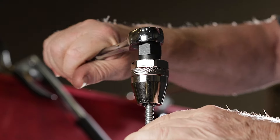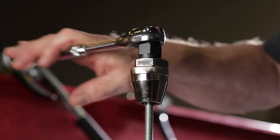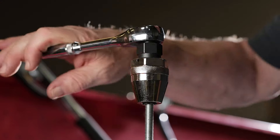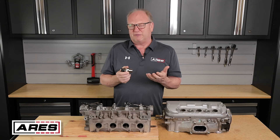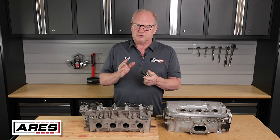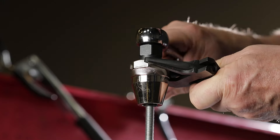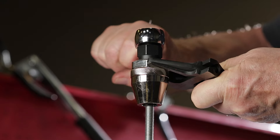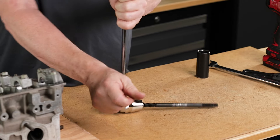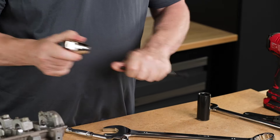By using the 3/8 drive or the 15/16 inch hex, you're putting tightening force on the stud, which helps it grip and not slip off. There's really no definitive answer — I can see where the other method will work — but using the center spindle is the way you're supposed to do it. Don't be afraid of getting it too tight on the fastener. Once the fastener or stud is out, you'll be able to use the double wrench method to loosen the teeth and remove your fastener.